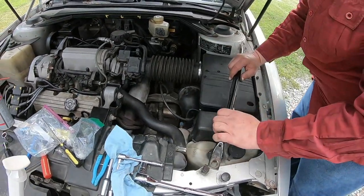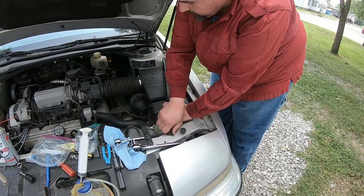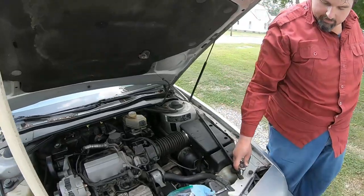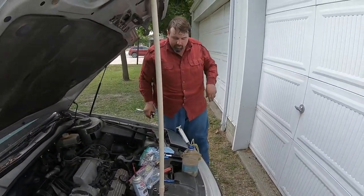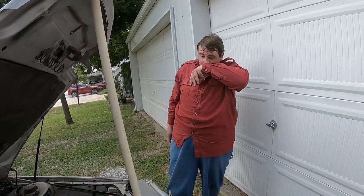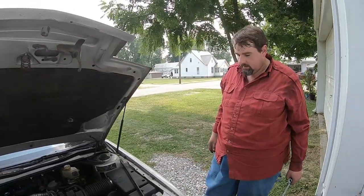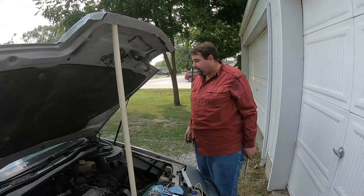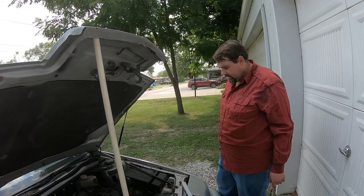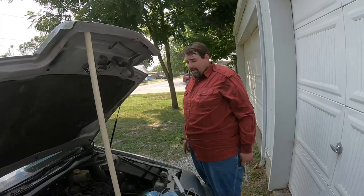There's wiring that's in the way, as always. Now you put this back on — should have the bolt there, which is missing, but I'll just do the one here for now. These are stabilizer bars — they reinforce the strut tower. I won't tighten this super tight but tight enough so it's not rattling around. I'll have to tap and drill this in at some point. It's cross-threaded, so I'm probably going to have to drill it out and re-thread it, then get a new bolt. What's really bad is I think I've got to buy a new drill bit because the one in my tap and drill set that's that size is the one I broke.